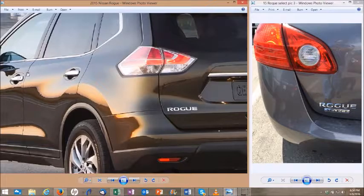On the menu systems, you go to Nissan North America by vehicle, you select Rogue, and on the menus you're going to see up to 2013 on the bladed ignition. That is going to be your Select. So be careful, because the Select does run all the way to 2015. If you have a 14 or 15 model, you still select the 13 on the menu. And on the Rogue with the 20-digit number, it's going to be the 14 plus on the menu. That's pretty easy to go by on the bladed ignition. So just make a note of the differences between the two, know which one you're working with, and everything should go very, very easily for you.